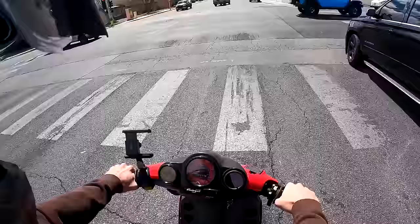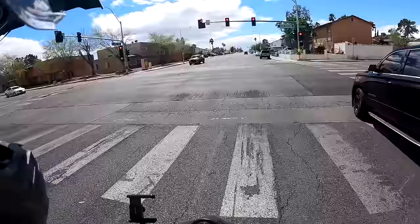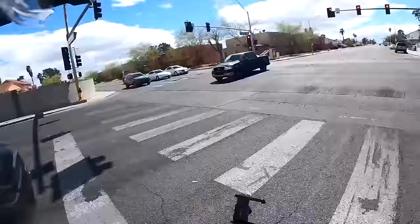Carb still needs a little bit of tuning on that bottom end. We need to do some plug chops and actually see what we're dealing with here. It's a little harder with the water cooled because the temps don't change as much, but we're definitely staying really, really cool. So I think we can lean it out a little bit.